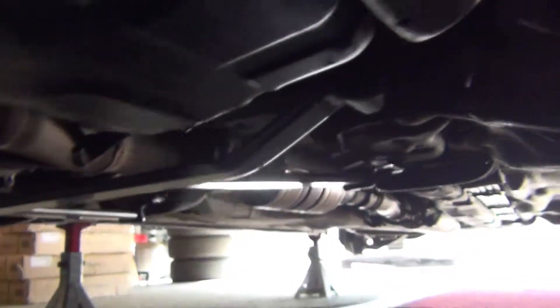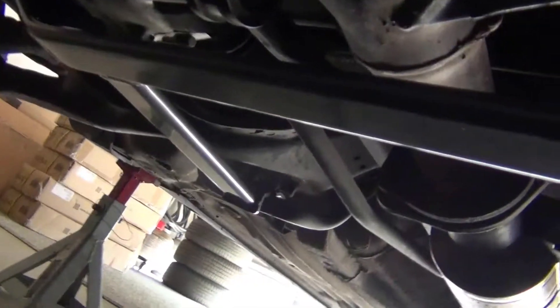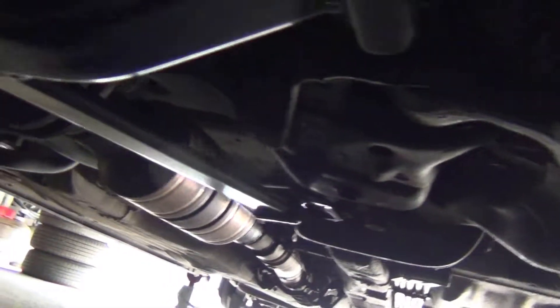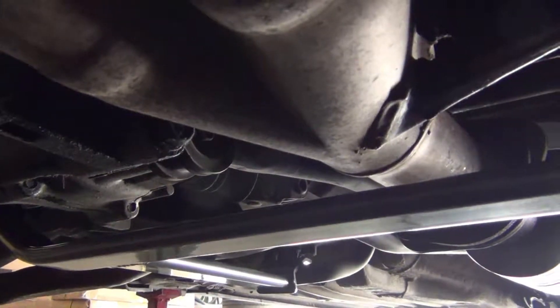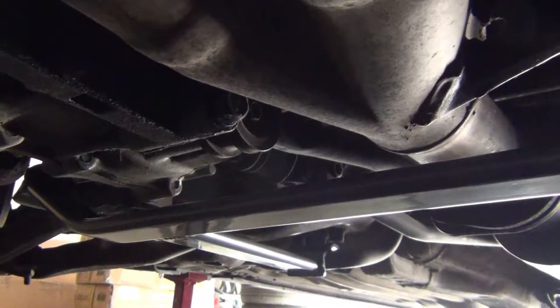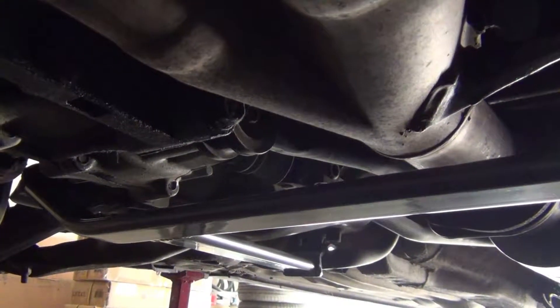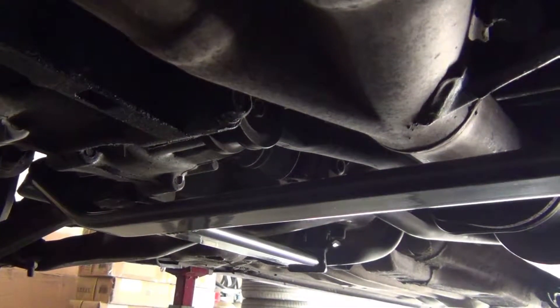So you can kind of see the H-brace — that's what it's called. It stiffens from these arms all the way across to these arms over here, and then back to these mounting points which are right next to the sway bar. With this, it barely clears the header — not very much clearance there. So if you end up using something like a Mugen header, which is for all B-series, it has to be a header specifically for a B16 and it might clear it. Anything else is going to drop down a little lower, and therefore you will not be able to use this H-brace.